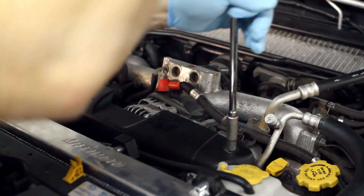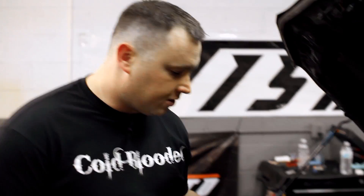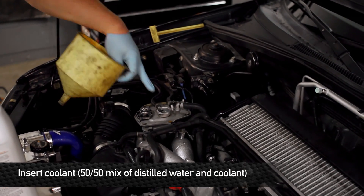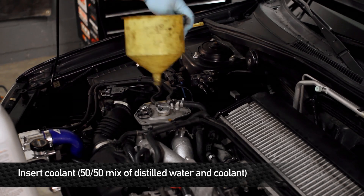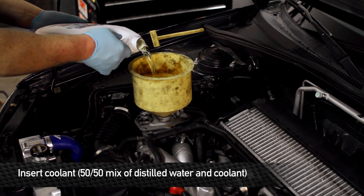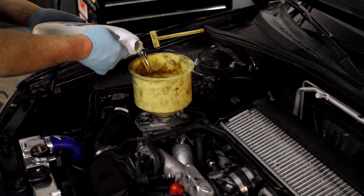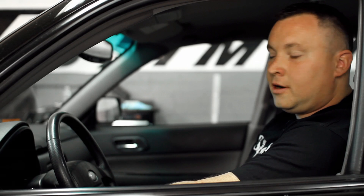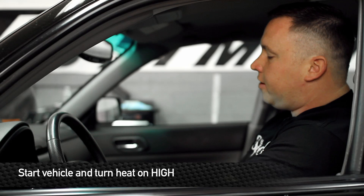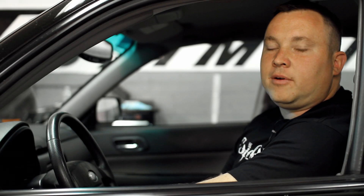We're just about to refill it with coolant. We're going to lower the car down first and then begin the refill. After you make sure all your hose connections are tight and hose clamps are on everything, go ahead and begin refilling the cooling system. On this particular model, you're going to be refilling it on the reservoir on top of the engine. Always use a 50-50 mix of antifreeze and distilled water, and don't be surprised if it takes considerably more coolant to fill the entire system. After you've filled up the entire radiator and there's no more air coming out of the reservoir, make sure you have no leaks under the car, then go ahead and start it up. During the first start, you should always turn the heat on high to evacuate the air bubbles from the heating system.